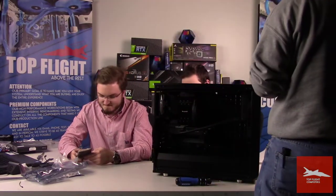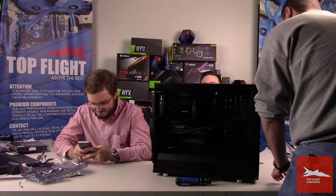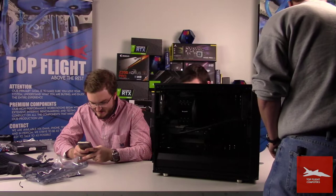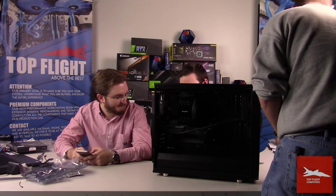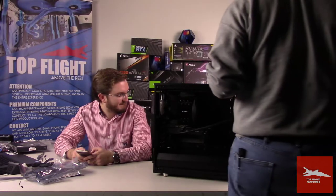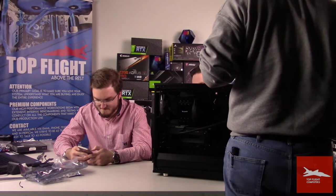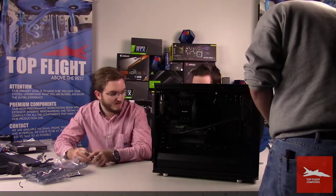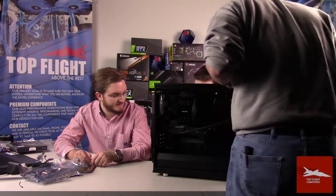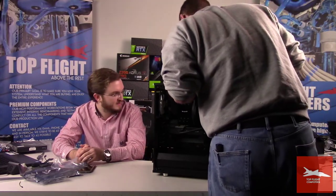One of the easiest ways to tell is just Control-Alt-Delete and pull up Task Manager, then go to Performance. It'll show your CPU and what it is, and you can do a quick Google of that. Is that overclockable? For Intel, at least, if it has a K after it, it's overclockable. That would tell if the processor can be overclocked. You'd have to look at the board too. Correct, but at least that's a good starting point.